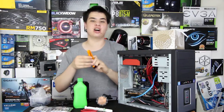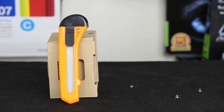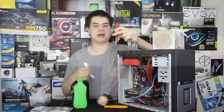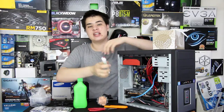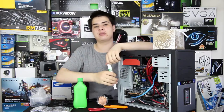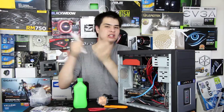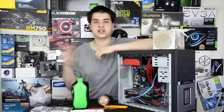You'll also need isopropyl alcohol and tissues or paper to wipe things off, and optionally an anti-static cloth. Have a knife, scissors, or side cutters to cut any zip ties from cable management, since we will be removing the motherboard. You'll also need some thermal compound and a pair of pliers in case a standoff gets stuck. For thermal compound, something like Arctic Silver 5 is recommended — just make sure it's non-conductive.